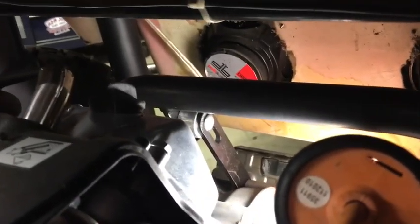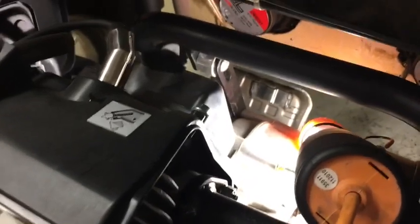One other thing you really want to watch out for: there's a spacer there. I used the one-inch spacer they included but they're a little bigger than spec, so I ended up cutting off about a quarter inch to get the right spacing. What you don't want to do is mount up your exhaust and then crank it way over - that was at least an inch of misalignment - because you'll misalign your exhaust and end up with backfire-type issues. Just a key point.